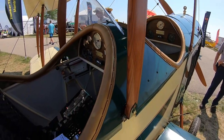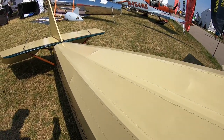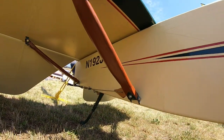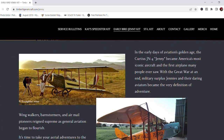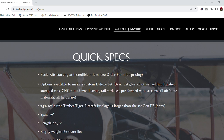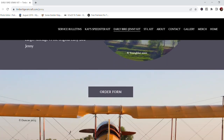It's just that times have changed since it was first designed and it's time for a reboot — we're talking 20 to 30 years ago. Originally the engine of choice was the Geo Metro type, a three-cylinder with a belt drive. With about 100 of them flying, all kinds of engines have been used. We're going to stay with the most popular ones: Honda conversions, Geo Metro and Suzuki conversions, the Rotax 582 — which was widely used and provided excellent power-to-weight and was actually one of the highest-performing models — and the Rotax 912. People have also used UL Power and HKS. There are one or two flying with a two-cylinder Franklin, which is a little light on power, so I wouldn't recommend that. On the kit versions we recommend anywhere between 70 and 100 horsepower.